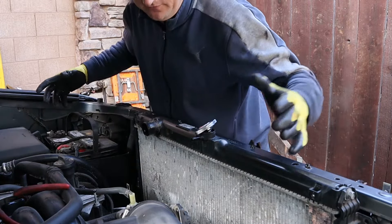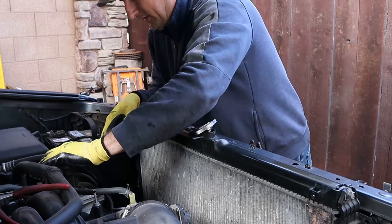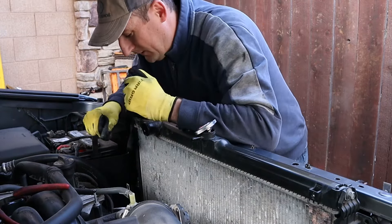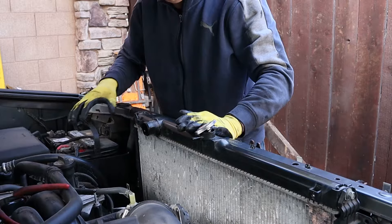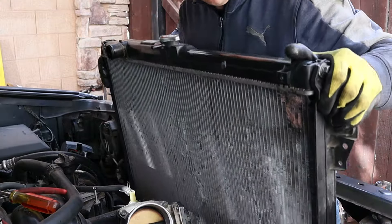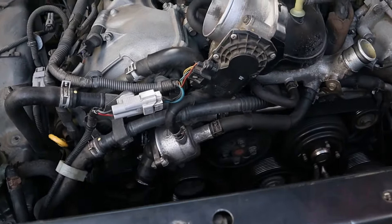Next I'm going to disconnect and take out the battery because I need more access from the side, since we'll be taking the valve covers off — the front cover is tight to the valve covers. Just in case, to make access to tight areas, I'm also going to take out the air filter box and the battery. It's simple — just 10 millimeter bolt and nuts, loosen the cable and take it out.